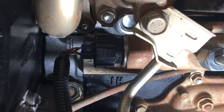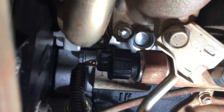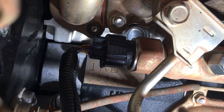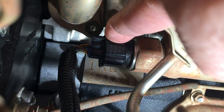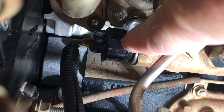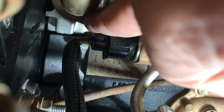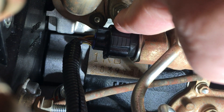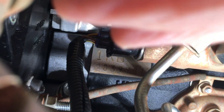There's the plug, center of the picture. The first thing you need to do is identify where the little release tab is. I'll reach in there, get my finger, feel the plug and work out where that release tab is. It's not on this thick section here — it's behind it. So it's behind the edge of the plug, about 12 to 14mm back. On this 120 Prado it's at the top. I'm not going to press it yet because then it may be released.